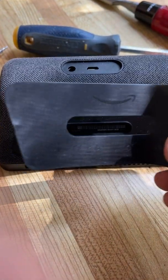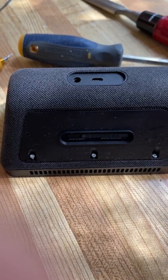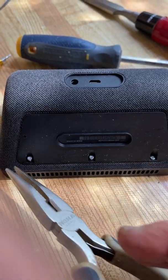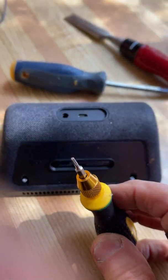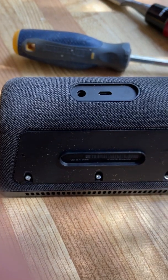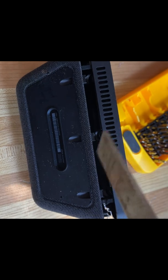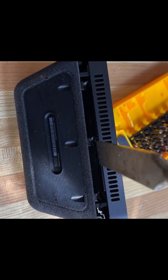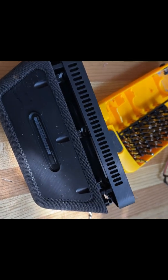Remove the bottom label and take out the three screws, which are small star type screws. Then pry the case apart from one of the corners. I used a chisel right around the center of the screws to bend it like that, and it cracks open.